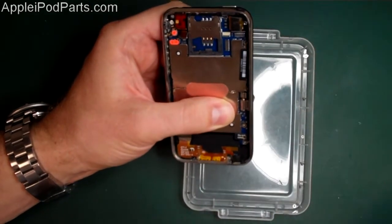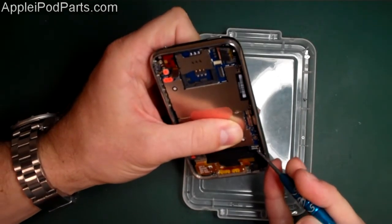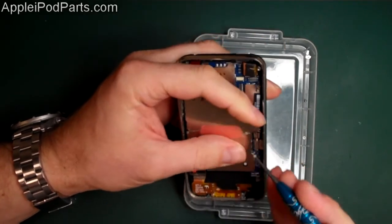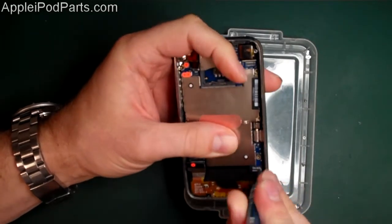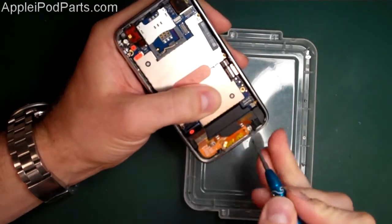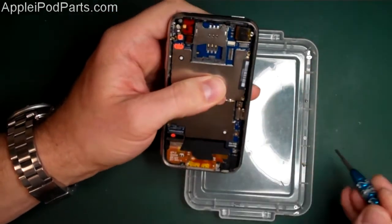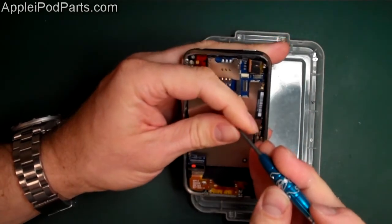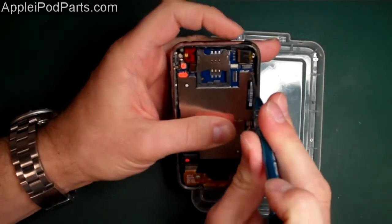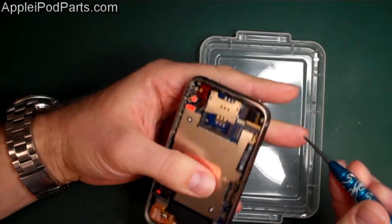So that's the board in place. We're going to put a couple of screws in place now, starting with the long non-shank screw that goes through that warranty label - that should just hold it in place. That screw's in place. Another thing to watch is that little gold connector spring clip - you've got to make sure it's not underneath this metal bit, it's actually resting nicely against it - that'll give you good signal then. So we'll work our way round with the screws on the board now. Because they've located on those little lugs, those little pins, we pretty much know there's no real need to do things loosely then go round them again, but if you want to, it's good practice really.